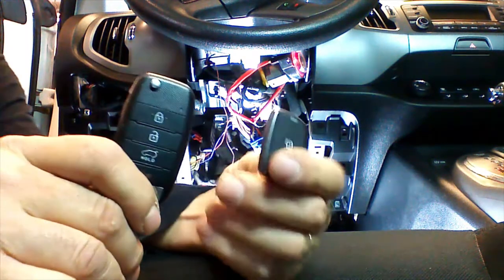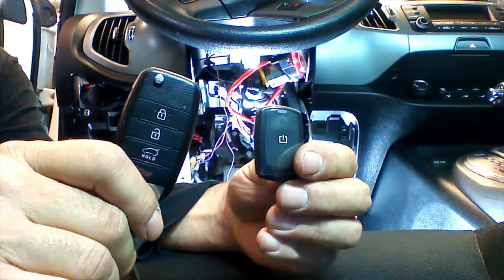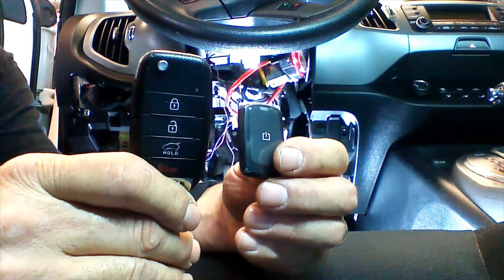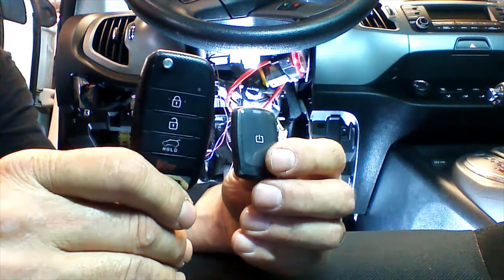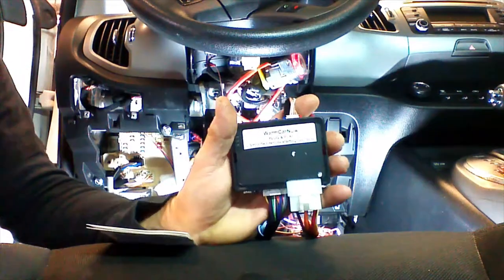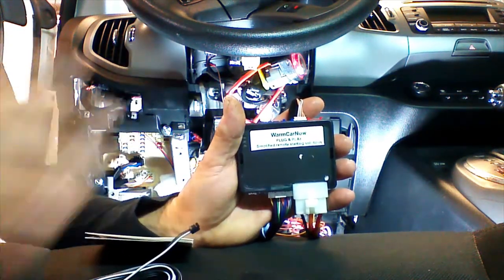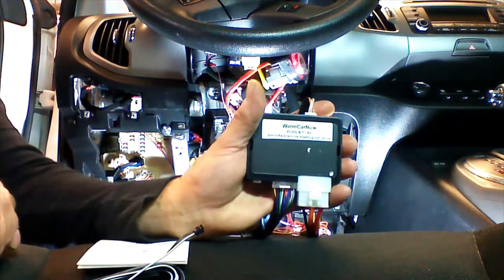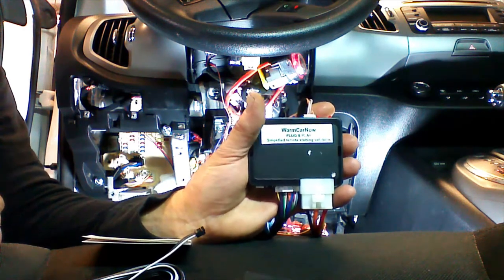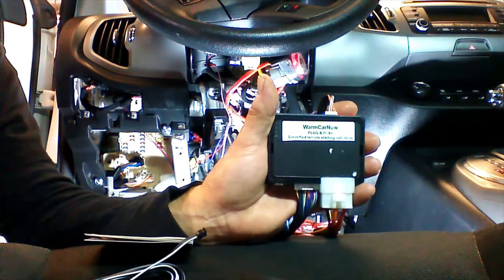We're going to pair our device with the RFK411 single-button remote, which is capable of locking, unlocking, and starting the vehicle. This is a solution if you don't want to have to put the key in the door lock to unlock the vehicle while the engine is running in remote start mode. When you purchase the RFK411 and EVO1 combo from us, we pair the RFK411 to the EVO. If you're upgrading a product purchased from us, we can send you a private video showing how to pair your remotes to the EVO — we have a pairing video for every scenario.